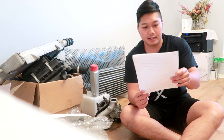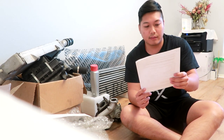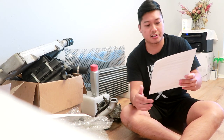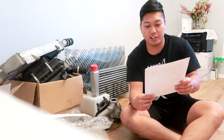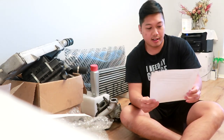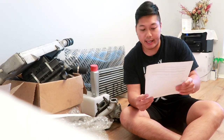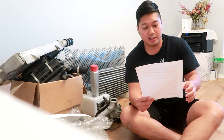For the MAP sensor, a Rallyart or Evo 10 OEM MAP sensor, or the Omni three-bar MAP sensor works — it replaces the stock one-bar sensor in the intake manifold. For injectors, you can use either the OEM Evo 10 injectors or the Rallyart injectors. The guide recommends that if you buy used, you get them cleaned — I did get the Rallyart injectors. For the fuel pump, you can use a stock OEM Rallyart or Evo 10 fuel pump, or if you want aftermarket you can go with AEM's 50-1200 fuel pump. For wideband, they recommend the AEM wideband which tracks your air-fuel ratio — that's what I got. I also got an AEM boost gauge.